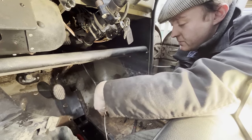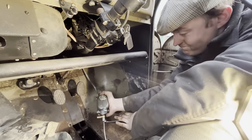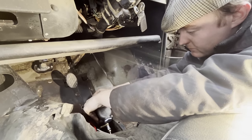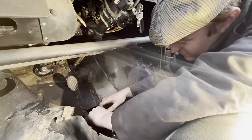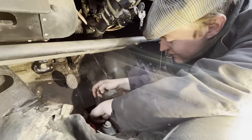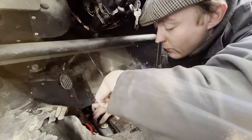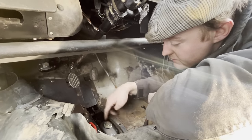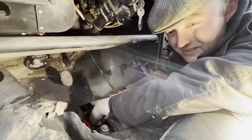I want to make sure all this is good because we never see this one again once this is in - it's in the chassis rail, all these fittings, so you just sort of have to hope you've done it up tight enough. After a slight rookie error, it's in. I couldn't get the push rod over the rubber boot to stop the stuff getting in. So I ended up pulling it out, taking the rubber boot off and then putting it over the pin first, then putting the pin in, then putting it all back down. Wind this threaded thing on and then it's in. It's working with the pedal now, which is good. And that's going to obviously need further adjustment once we find out how far it needs to be.